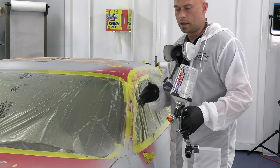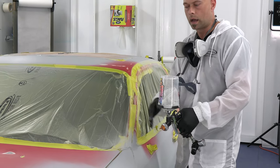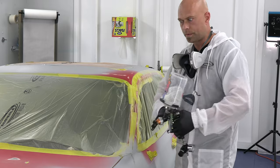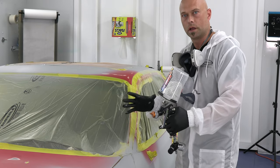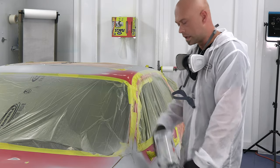We call it paint chop — it's going to have that little ripple to it so it'll actually look like a dent. You can actually create dents by improper priming — by putting a lot of material on and just letting it go, thinking you're filling your dent. But you're really not. You're actually creating a dent somewhere else.